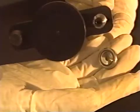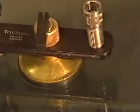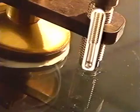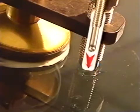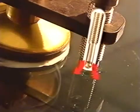In the uncommon case that an impact point is too large for the injector base to seal over, use the large pit adapter and the large O-ring that come with your professional windshield repair kit. The Tri-Glass double O-ring injector is especially designed to cause suction, as it is unscrewed to remove the trapped air. As it's screwed in again, the pressure forces resin into the area from which trapped air was removed.